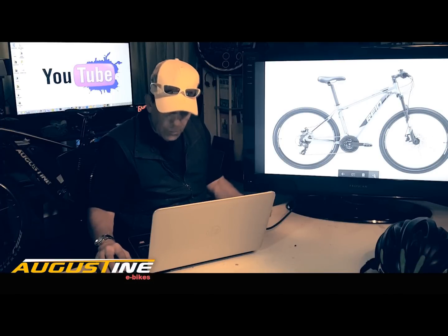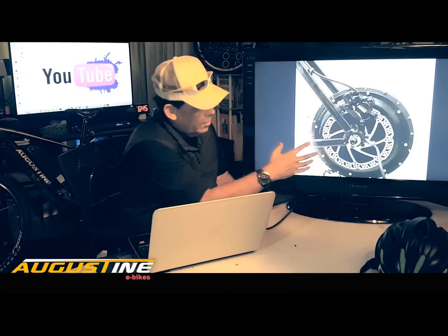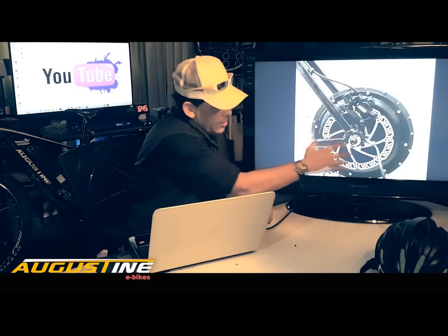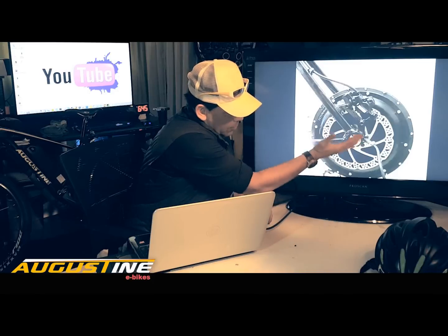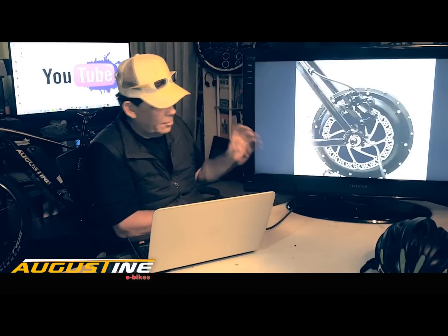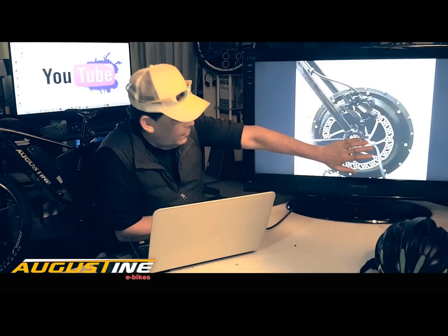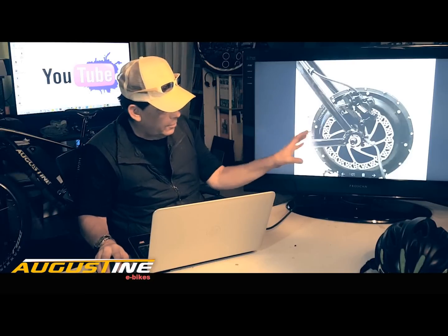There are really three working parts. You need a motor. In this particular video we're only focusing on a rear hub motor. You can have a mid-drive which basically replaces your crank and drive system — they're more expensive, a little more complicated, and require more maintenance. These rear hub motors are pretty standard. The standard size dropout is 135mm, so you just basically take out your own wheel, put the wheel in with the motor, and you're pretty much ready to go. This is more of a plug and play system. Mid-drive offers higher torque and is better for off-road, but if you want to commute or ride 40 miles, the rear hub is a great solution. They're relatively inexpensive, they'll last forever — they're terrific motors.